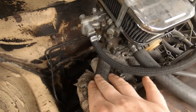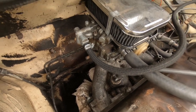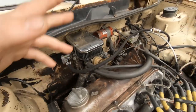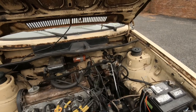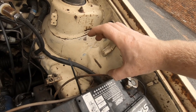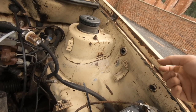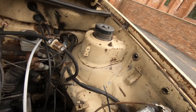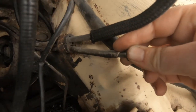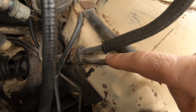Basically, if you get a pair of channel locks on here and wiggle the injectors out, they just pop right out. And then the fifth injector is just held on with a big banjo bolt — break that bolt loose, pop that fifth injector off. We've got a bunch of vacuum lines too. Near the top of your air box, you can have a big can with one of the fuel lines coming off of it — again, banjo bolts. You'll have your feed and return lines sitting on top of the air box.